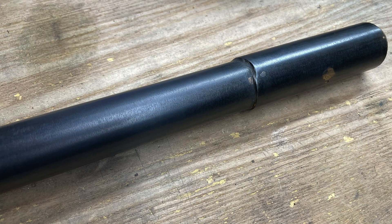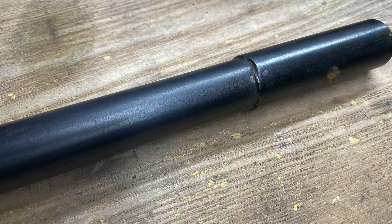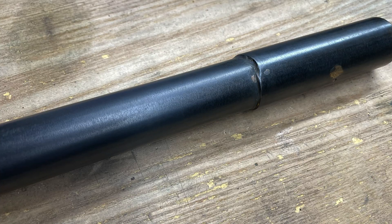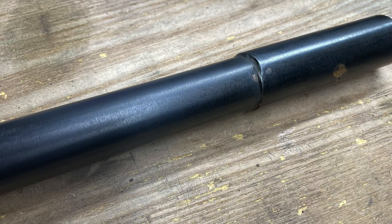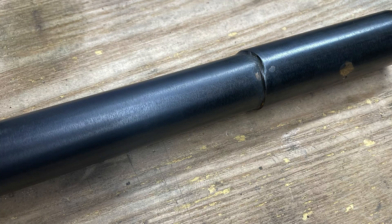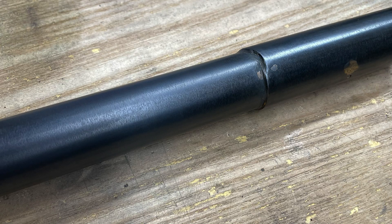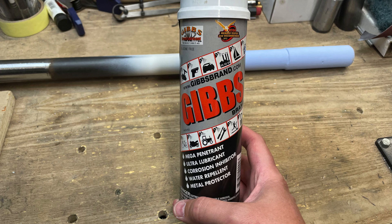Cold bluing's biggest drawback is that it needs a bit of maintenance to keep it rust free. It offers some rust protection, but not enough for a bike that gets ridden. To get some additional rust protection, I oiled the frame. When I was looking for products to put on bare metal, I came across some hot rodder forums. Custom hot rod builders will occasionally leave their steel car bodies bare, and one popular product is Gibbs lubricant. It comes in a spray can — I spray some on a rag, wipe a thin layer on the tubes, leave it for a few hours, then wipe off any excess. I did that same process on the painted section of the tube to see if Gibbs affected the paint or primer, which it didn't.